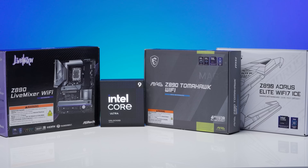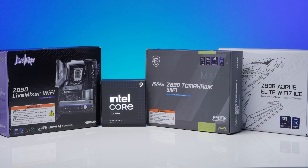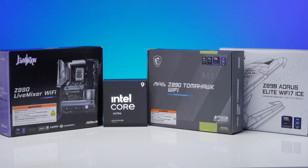That's it for this video. We walked you through a step-by-step guide for every motherboard manufacturer, showed you the performance data, and now you have everything you need to enable Intel Core Ultra 200S Boost on your Z890 motherboard. Your mileage may vary — Intel claims up to 16%, we saw up to 10% at one point, and it's all dependent on the board, the chip, and the applications and games you're using.